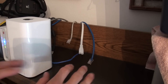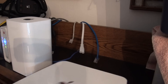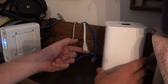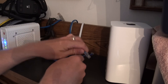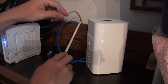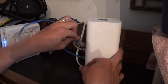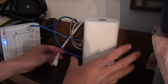I'm going to do this the best I can with the space I have. You can see with all the cords on the 2TB model, I was pushing it out to the secondary shelf. With the new 3TB, it fits nicely alongside my Motorola cable modem. I've unplugged everything out of my 2TB — I have the power cable, the cable coming directly off my cable modem going into the WAN port, and connections going to my computer and switch for all my other devices. And then a short cable going from the 3TB to the 2TB to port the settings over.